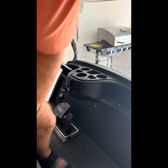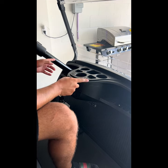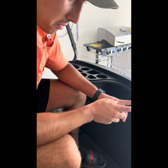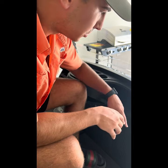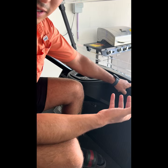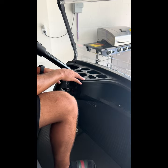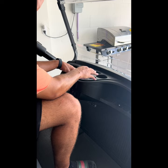Starting with accessing the headlights — there are two ways to do it. One, you can go through this top panel, which I personally find to be the easiest. Second, if you have a non-lifted model without fenders, there are pull tabs at the bottom of the fender well. But I'd rather not do that since you risk damaging the little fasteners that hold the panels in.